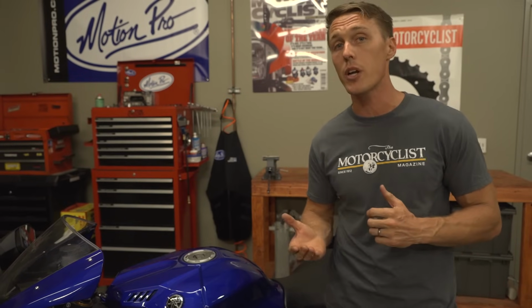If you're unable to nail your sag figures with the adjustments available on your bike, that's a good indication that your spring rates are off. If you've maxed out preload and you still have too much sag, that's a sure sign that you need stiffer springs. On the other hand, if you've pulled all of the preload out and you still have too little sag, your springs are too stiff. The ideal setup will have very little preload to achieve the desired sag figures.